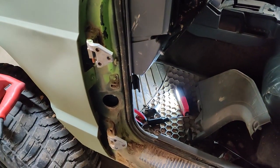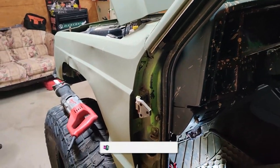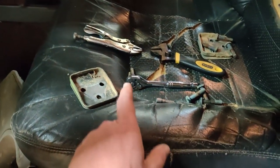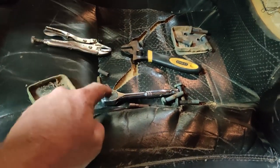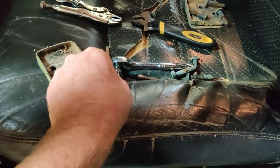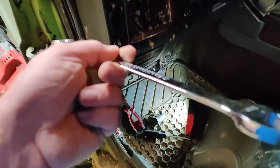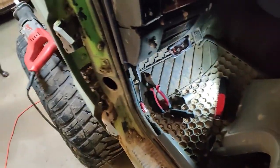This is a quick video for you guys if you want to take your Jeep doors off — this is a 95 XJ. It's three bolts on this hinge and three bolts on this hinge. It's a T40 torx bit. I've got a small ratchet and socket holding the T40 — I think it's a 6.5 millimeter — and I used a three-fourths wrench to give me leverage to push down and take these bolts out, because they're in there pretty tight.